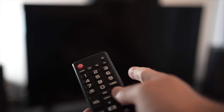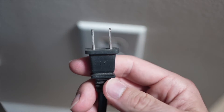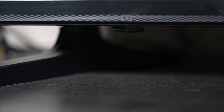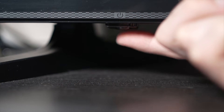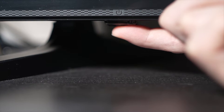So let's start with the first one. Turn your TV off and unplug it from the wall socket. Now, depending on the model you have, you may have a power button on the back or one on the front under the TV. If you don't find one, don't worry, just skip this step. But if you found one, keep it pressed for 30 seconds.